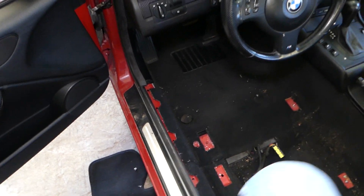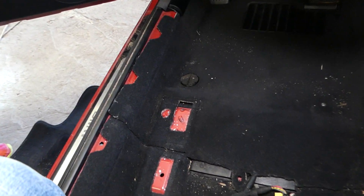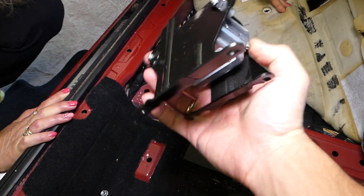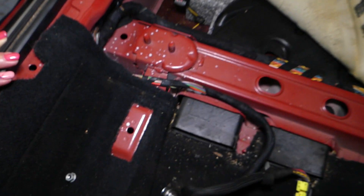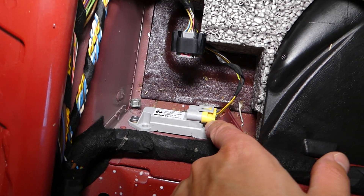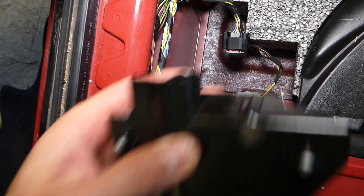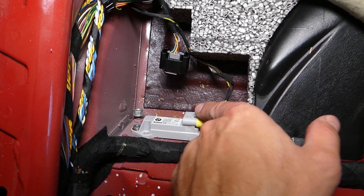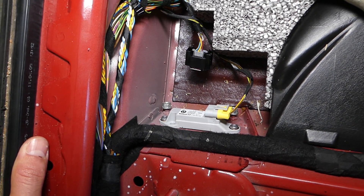The driver's side is a little bit different and I'm going to explain why. When you lift the carpet up, you're going to notice a box in that corner — that is your traction control sensor. You will need to remove the traction control sensor to get to the airbag sensor. The detailed video for that is on the channel — check it out. That box goes like this, so you will not be able to see the airbag sensor at first because it will be hidden. Once you remove the traction control sensor, your airbag side crash impact sensor will be right here. Super easy — you can locate it after that. So that's where they are.